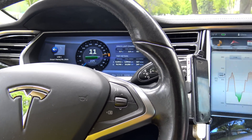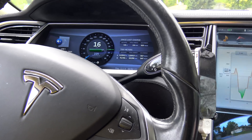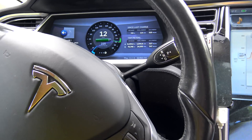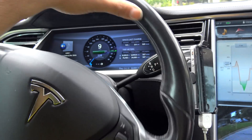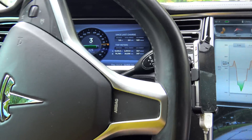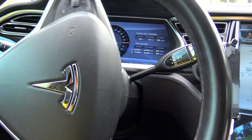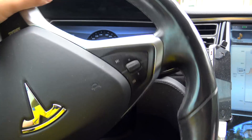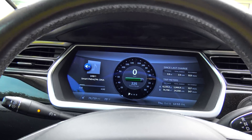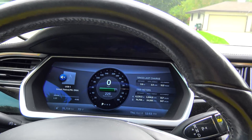The confusion was: what happens when the brakes fail? How does it still work? Well, the Model S has six calipers — two standard on the front, two standard on the rear, and then two emergency electronically actuated parking brakes on the rear. That's a separate, its own little subsystem. So if your main brakes somehow fail — hydraulic leak, vacuum boost or vacuum pump leak, breakdown failure, or electronic assist failure — pressing and holding the parking brake enables these electrically actuated secondary braking system to stop you and slow you down.